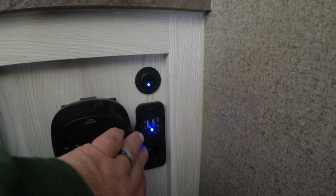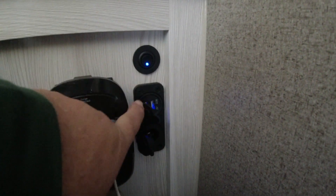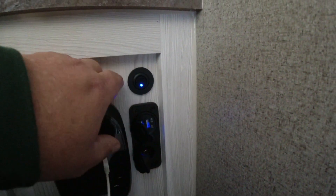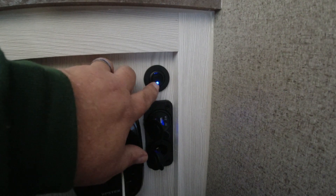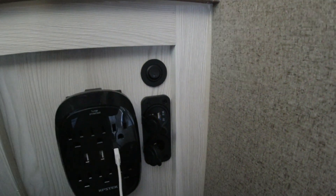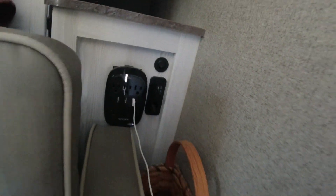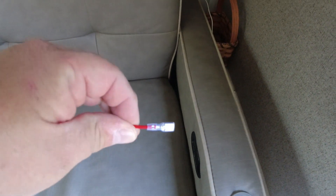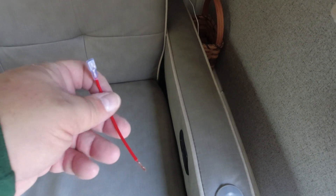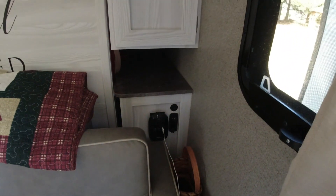You can actually eliminate a lot of this problem if you buy a setup that already has the USB and cigarette lighter with a built-in switch. But this is another way to show you how to add a 12-volt switch, and what's nice about it is it tells you when it's on or off. To do this project you need a wire stripper and swedge connectors — you can see here's one already swedged from the factory, and that yellow one I had to put on myself for the load wire. You'll need several different sizes of those connectors.